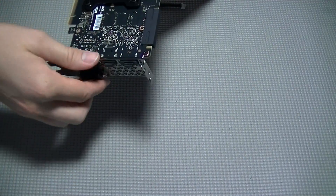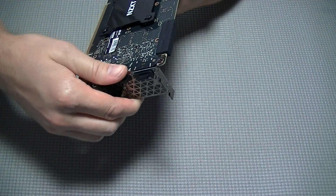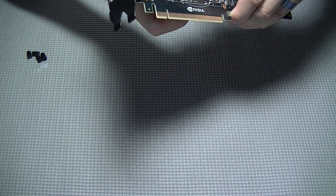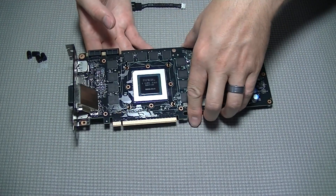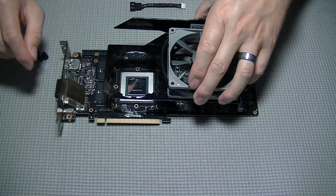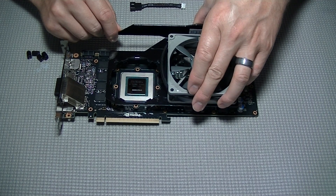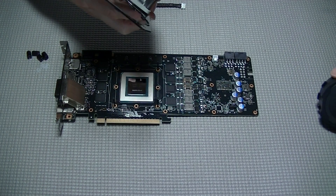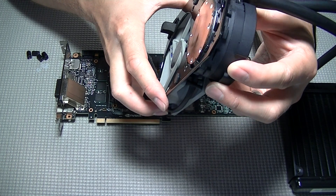With this cooling mod, I often get questions about VRM and VRAM cooling efficiency. For the VRAM, this is actually a better cooling method than a stock air cooler, because with a stock cooler the large GPU heat sink obstructs airflow directly over the VRM. Once that large, bulky heat sink with heat pipes and fins is removed, you'll either see the exposed VRM or, in some aftermarket models, a heat sink or heat spreader plate covering the VRMs. The VRM cooling fan is oriented directly over the VRMs, and without obstructed airflow, overall cooling efficiency will be much better than with the stock cooler.